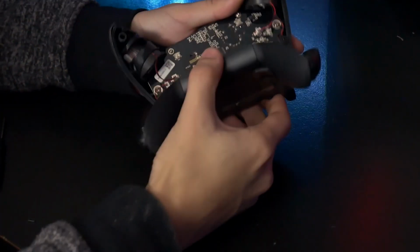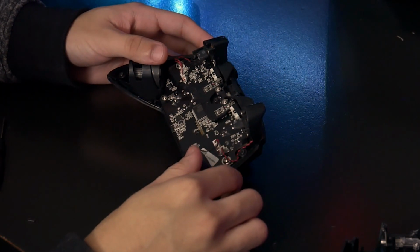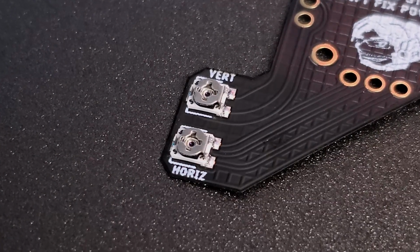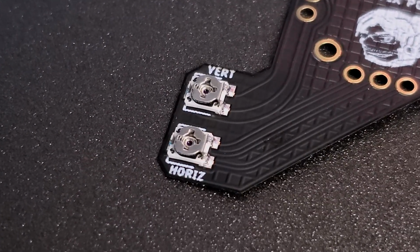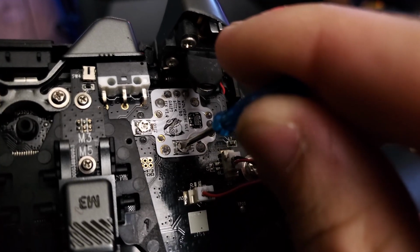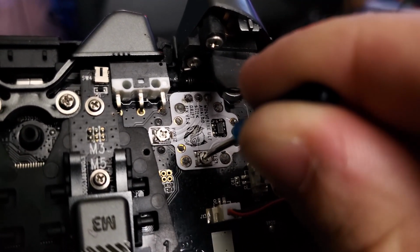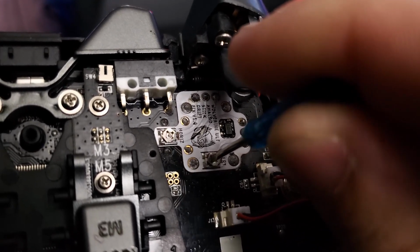So the way that these PCBs work when countering stick drift is they are meant to be soldered to the bottom of your thumbstick inside your controller. They, like the thumbsticks in your controller, also have potentiometers, the only difference being these ones can be manually adjusted using nothing but a screwdriver. So whenever your dead zone starts developing Parkinson's, you can immediately correct this. Or Alzheimer's or AIDS or cancer or anything like that.